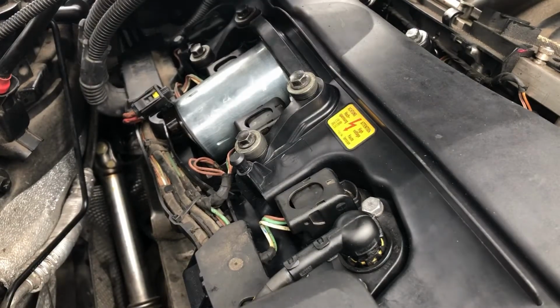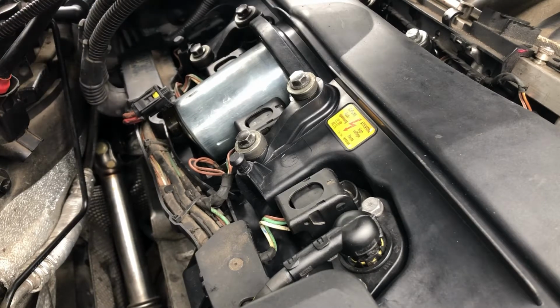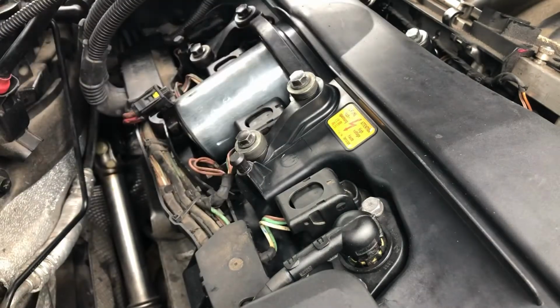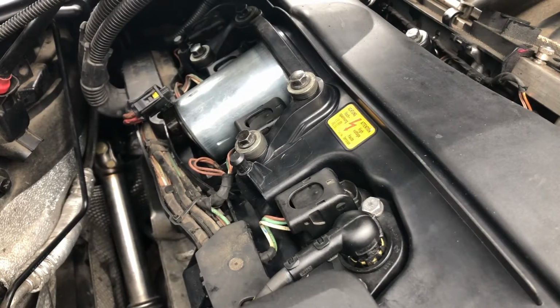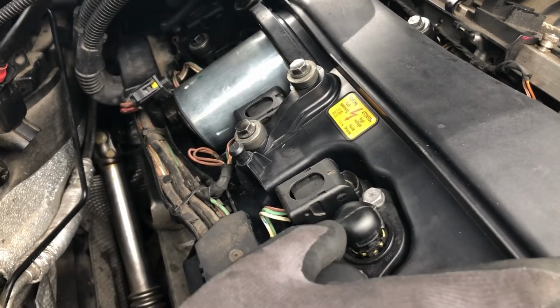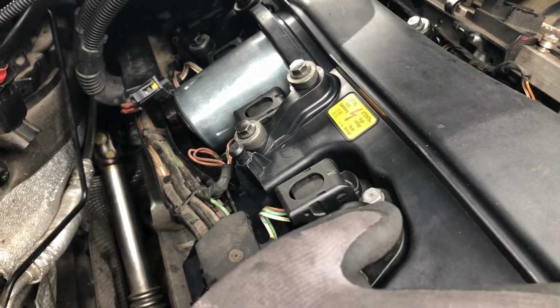And also at the back of the cam, you'll see it when you remove it, there is the top of a spring. There's a big spring in there, but all you can see is the top bit of it, like that. And it wants to get in the way of you sliding the rocker cover over the top with the new gasket. Just things to look out for, otherwise you could snag it or even pull it all out of line. So that's the main problems. That bolt in the top corner, right hand side at the back, was the fiddliest one.